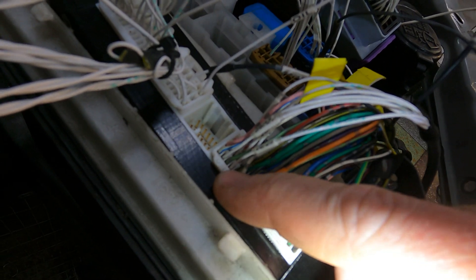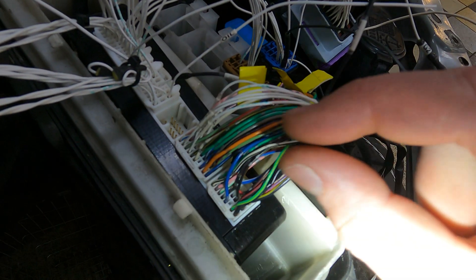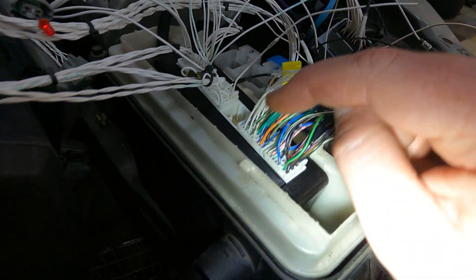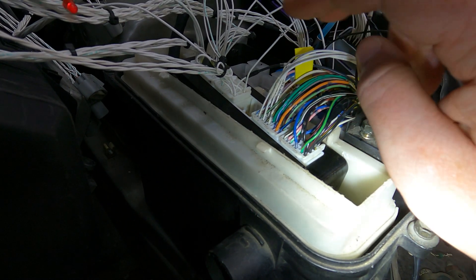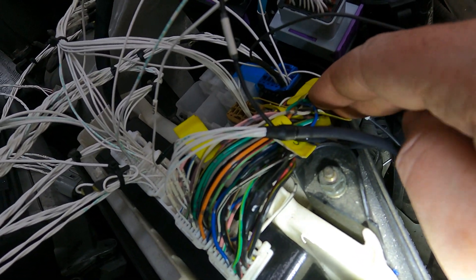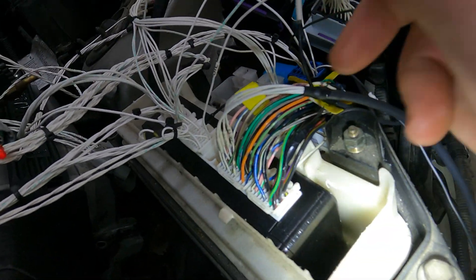These pins will be open on your car. Effectively you take out this plug — there's a little latch that goes all the way across, you use a small screwdriver to pick it and it comes out about a millimeter. I do have a video on how to de-pin. When you get it to your car, what we recommend is you go to the grommet at the bottom, make a very small hole — all you've got is these loose wires with terminals on them — and push them up through there.